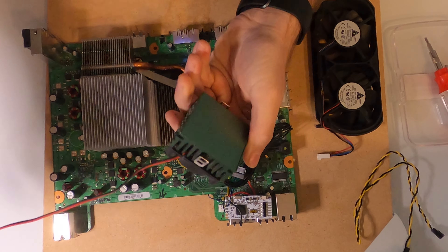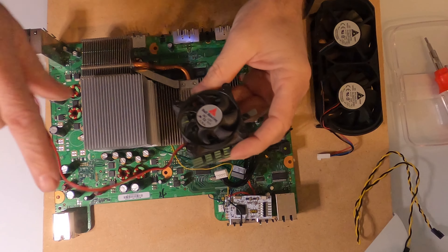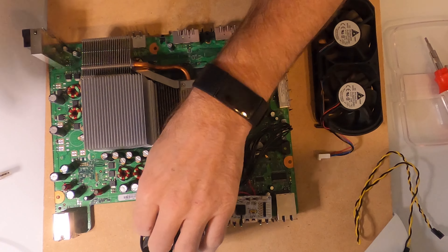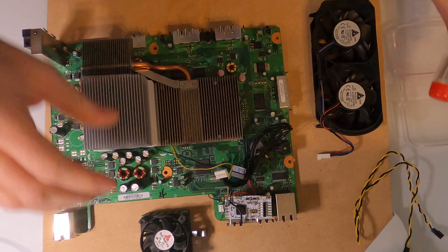So the next thing I'm going to do is go ahead and do a fan mod. I have this 12-volt DC fan that I pulled off an old Pentium CPU years and years ago. It's just been hanging out, so I'm going to try to use this one. It is important that you make sure you use a 12-volt fan for this mod. My plan is to remove this fan and mount it right here over the GPU cooling.